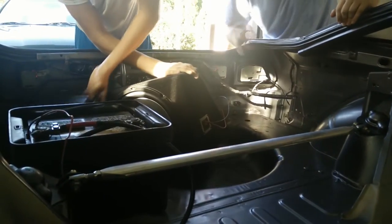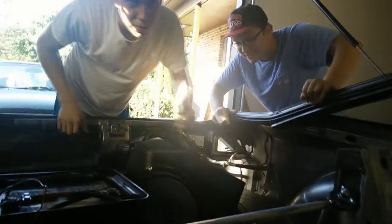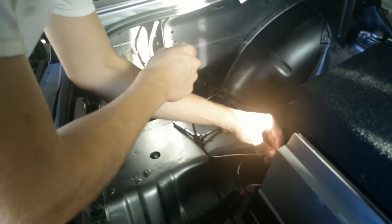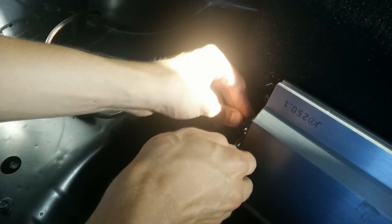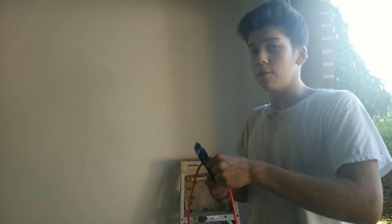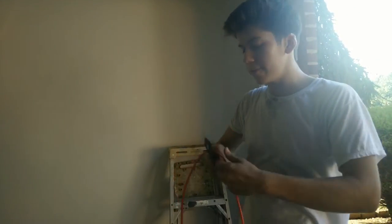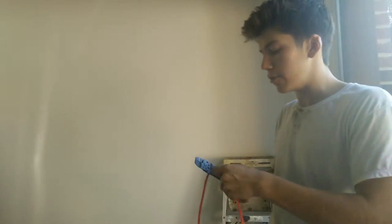You're on the battery tray. That's the battery box — we did that on the battery relocation video. Now you just play music and we have to go. I need to find somewhere to ground this. We had to make the hole bigger, and now I'm just stripping it and putting it in the ground. This is the easiest part. Make sure you disconnect the battery — you don't want to die. For my car, since my battery's in the back, I don't need much wire. You guys are probably going to have to use the whole wire because your battery's going to be in the front.